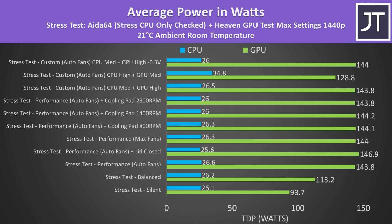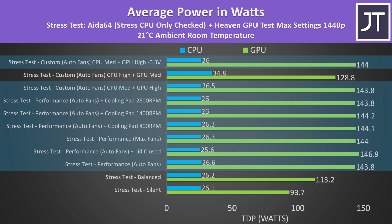The Nvidia control panel says the RTX 5090 in the Blade 16 can run up to 175 watts with dynamic boost, but with the CPU also loaded up at the same time, we saw around 145 watts best case. So not full power, but also not bad considering the thinner size of the laptop.